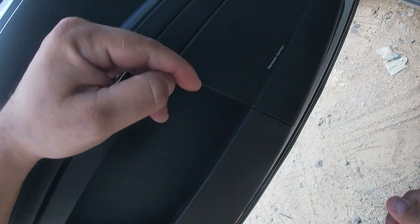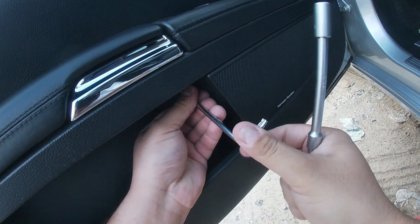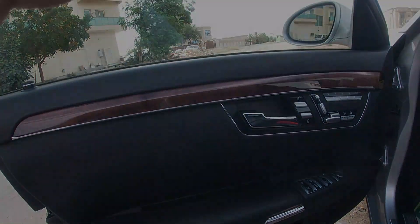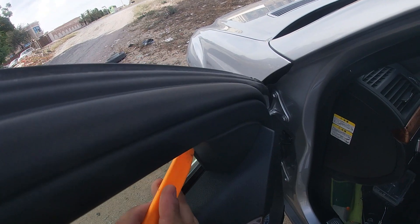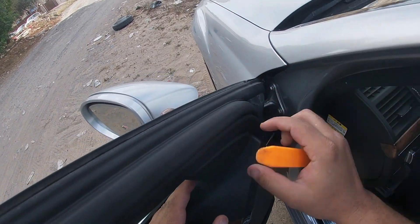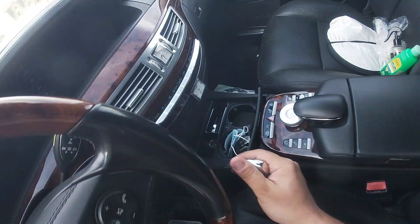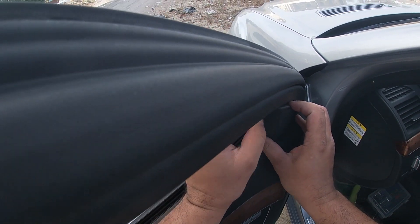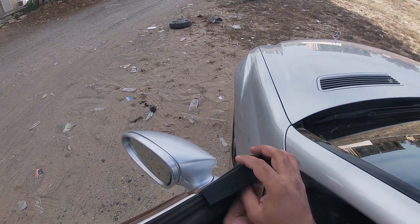This piece is dissolved — we have to remove it. From behind it was holding. Just take it away — no need to remove it fully. You need at least two pry tools together. Then with your hand, make the space. Once all corners are unclipped, if there is any clip in the middle, it is on hinges. To remove it from that hinge, you have to pull from the bottom upward.